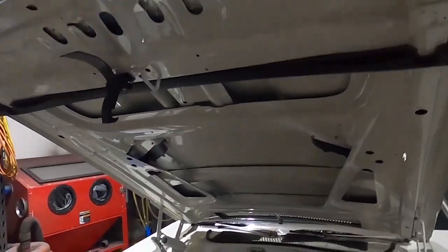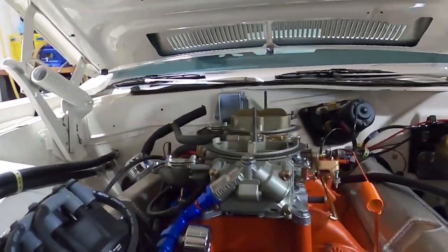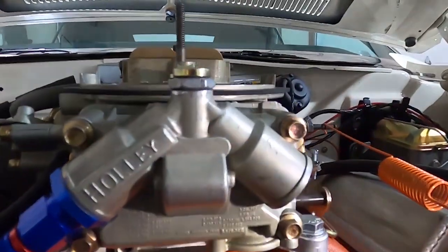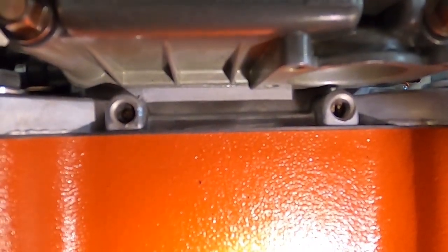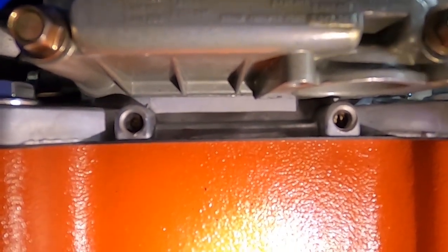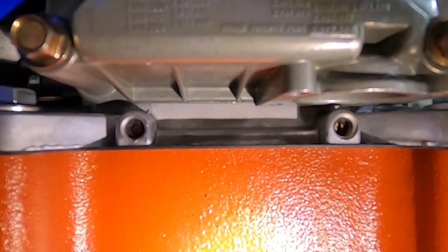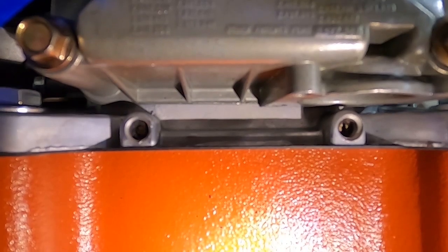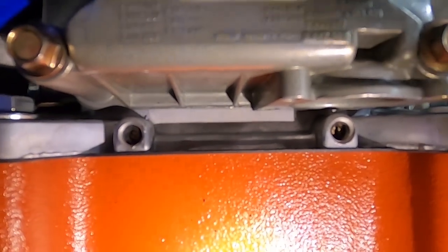When I got these carburetors and took them out of the box, I checked the factory settings. These came with the idle mixture screws for the outboard carburetors being out by half a turn. The outboard carb idle mixture screws are right there — those two holes — and you need a small slot screwdriver for those. Be careful not to overdo it: if you bottom them out, only go until there's slight resistance, otherwise you can damage them.